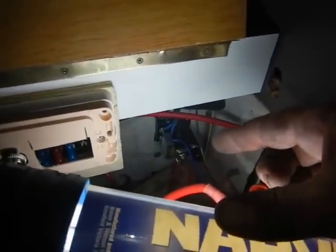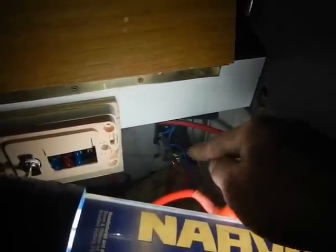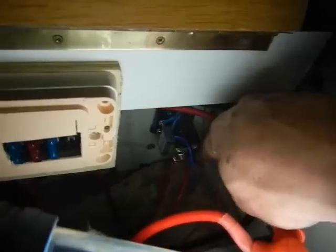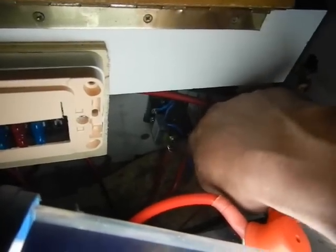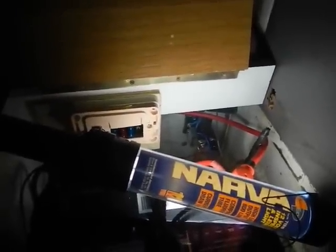I've decided I might as well run my wiring off the front battery, because that's the van battery, not the camper van battery. There's an isolation charger — so when the engine battery gets full it charges the camper battery. I think I'll tap my wiring off that side because that's a nice heavy wire. But that'll be tomorrow.